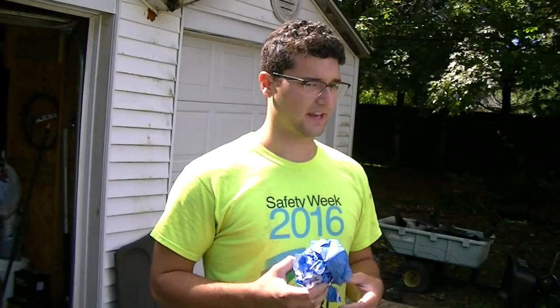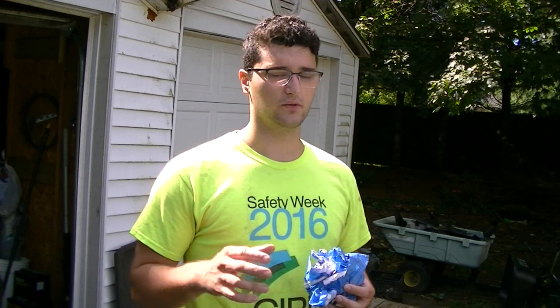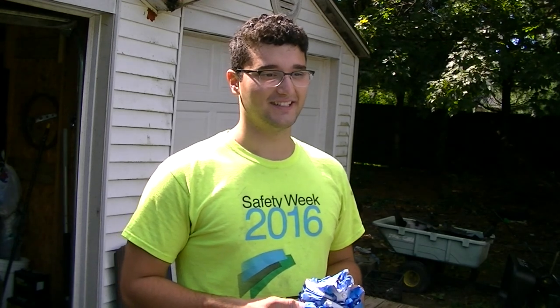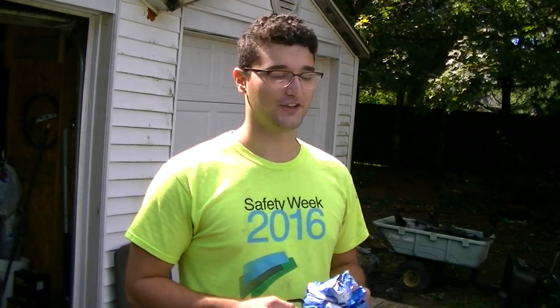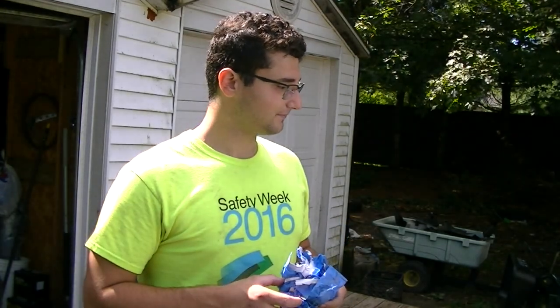Now that I have all that taken care of - got the tape taken off and all that other stuff - I'm gonna sand down the car again by hand using the 120 grit. Sorry I'm being quiet, it's still pretty early in the morning so people are still doing their daily routines. I have neighbors and I don't want to talk too loud, even though they're far away - just trying to be respectful. I'm gonna see if I can get that overspray off the windows because I got a lot of it on there. I did not think it would overspray that bad, but you live and learn. So I'm gonna work on that first and sand the car by hand, and then put it back together just to get it to the body shop.